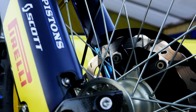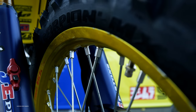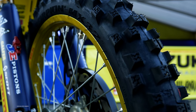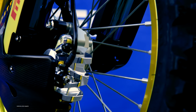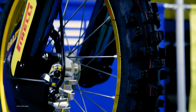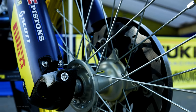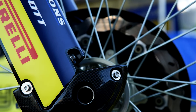Down at the wheel, we have the factory hub laced up to the yellow rims that we've been using since 2001. It has a Pirelli mid-hard tire, which is a mid-hard pattern. The carcass is a little bit stiffer than the mid-soft tire, so he prefers that for right now — outdoors we use the mid-soft tire. Down on the bottom there's a carbon fiber ski to ease it through the ruts. When leaned over quite a bit, the axle lug will dig into the dirt, so we use that ski to slide through.